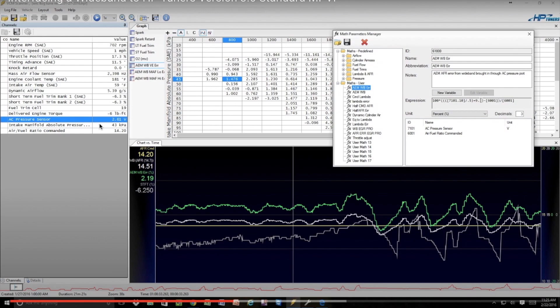You can also use the AC pressure sensor. There are some other sensors, but most of them — if you delete them and try to re-inject the wideband signal — affect engine operation, so you're very limited on what you can use. The AC pressure sensor and the fuel tank pressure sensor both definitely work. I did a lot of research and totally deleting the fuel tank pressure sensor has no effect on engine running whatsoever.